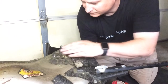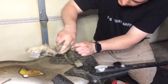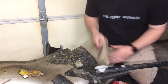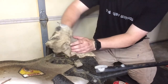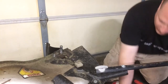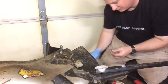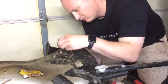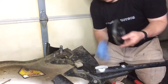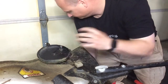Taking a towel to clean off that transmission shaft, spraying a little more lube and cleaning it again. For some reason on this mower the right side was really dirty — usually it's the left side that gets more caked up. Right now I'm putting a little grease on that transmission shaft and reinstalling the washer and the key, then putting the black plastic wheel guard cover back on.